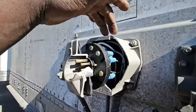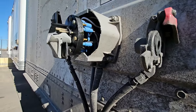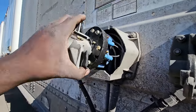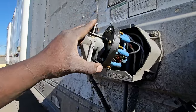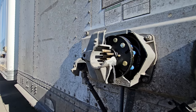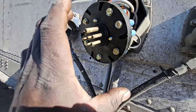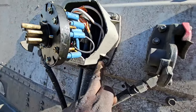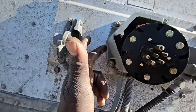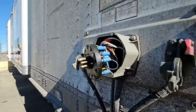Then the front cover comes off. And once that comes off, you can take off this back box and replace it with ease, because this won't get hung up while you're trying to take it off. I'm going to take it off and then show you how it looks when it's off. Once you take the torx screws off, the front cover comes off. Then you need to take off these half-inch screws to take off this box — I'll show you how it looks when it's taken off.